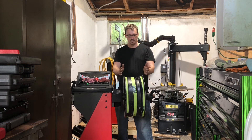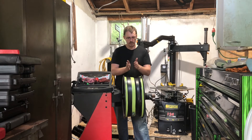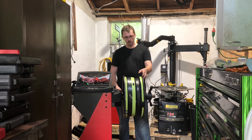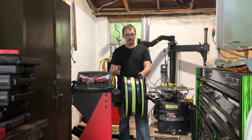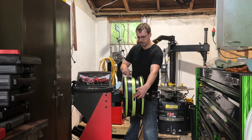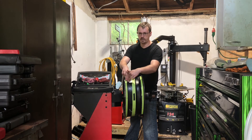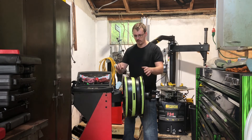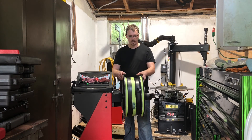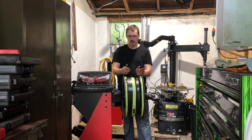So this side is zeroed out, and this side is now zeroed out. That's going to allow the wheel to rotate smoothly down the road without pulling left to right or tilting it in and out. Now these two spots also have a compensating effect to a degree for the static balance, because these two weights — say you have a wheel weight here and a wheel weight here — you're going to come to a point where they have a general gravitational pull. That is the effect of the dynamic balance points in the compensation for it. So you zero them out, you're not going to have the tramping and you're not going to have the pulling in and out.